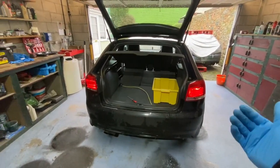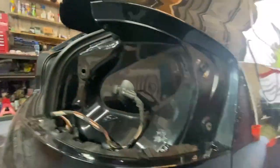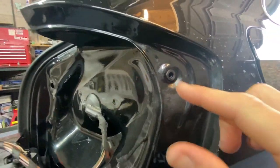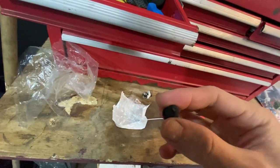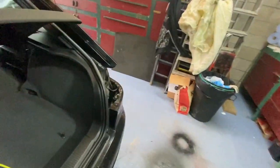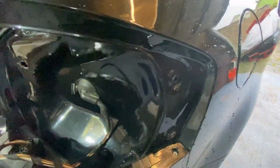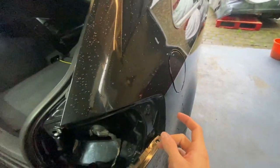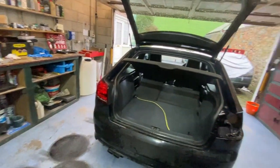I'm going to move on to taking this one out and getting the new one in. Already 10 times better. I've got this light out - these are the grommets I'm talking about. This is the original one and I've just put the new one in. What you want to do is glue the back of the grommet so that when you put it in, it resists from falling in if any pressure comes to it. That's glued in now, let that dry, and then I'll do the same as the other side - spray WD-40 on the hole and the light should just slide in without any issues.